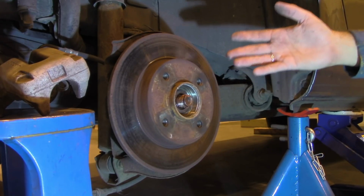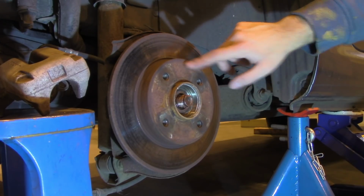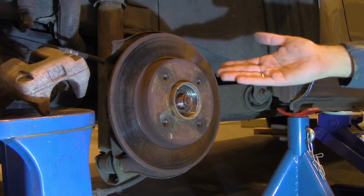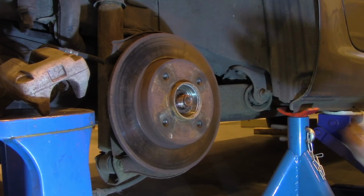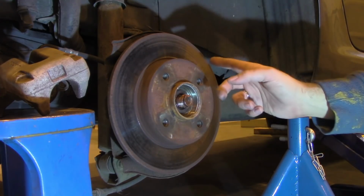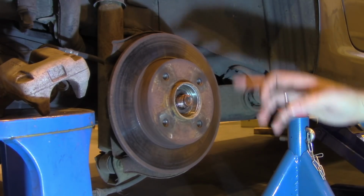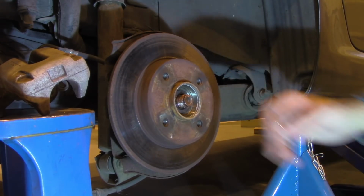But just to be sure, check the manual of the braking disc manufacturer if you're installing a new one, whether it requires any kind of application of chemicals. If you are installing the old one, it's always a good practice to spray it with alcohol just to clean it, but we will do that later on. Now we are going to install the nut.